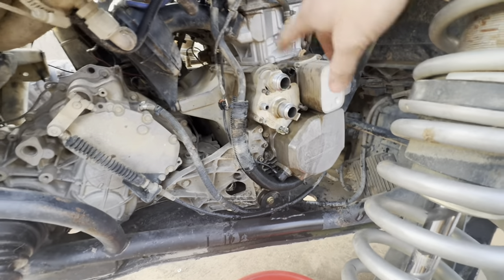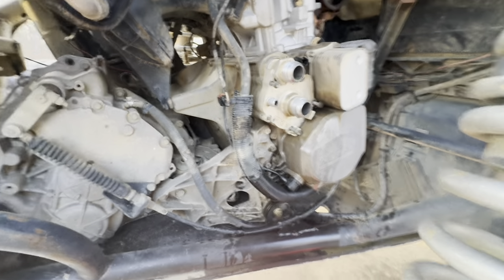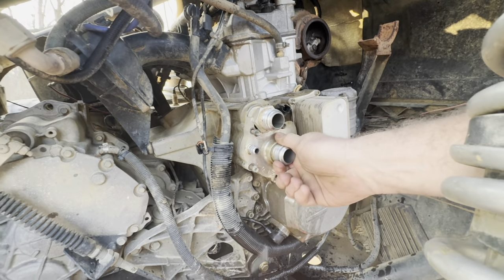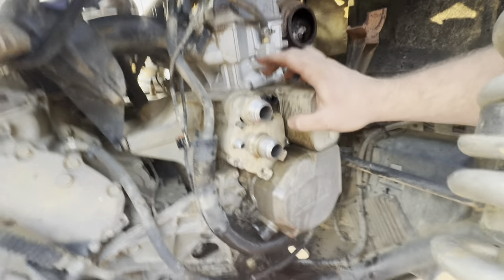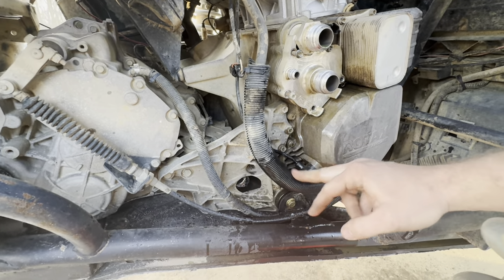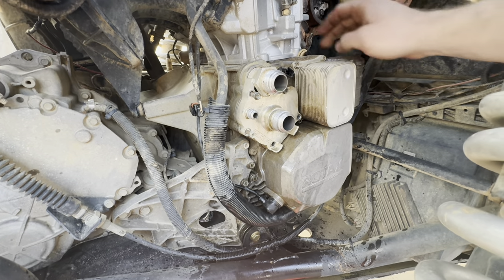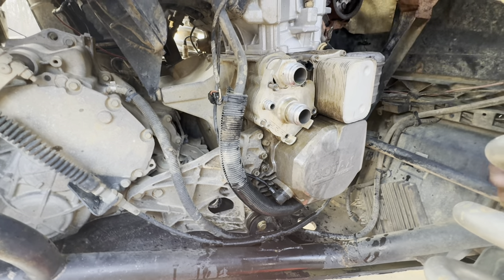First step you're going to have to do - I've got ZRP coolant lines because we got the radiator mounted up in the back, so we all went with 16 AN fittings on everything. You're going to have a few bolts to pop out around this area, this will come off, and you're probably going to get coolant everywhere. You'll want to take all your crank bolts, take the oil cooler off, take the oil filter out, probably unplug the stator, and that should get you into the side cover.